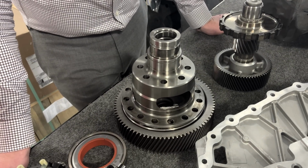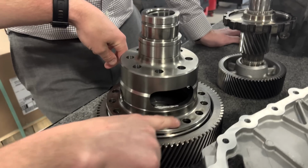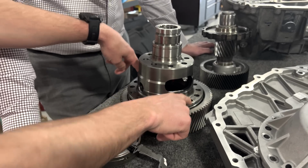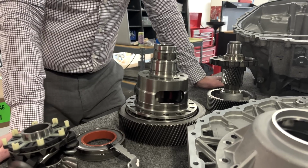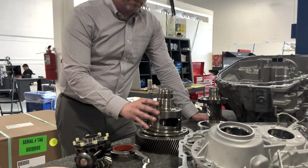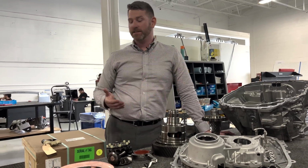The larger that hub is, meaning the span in terms of diameter between the hub face on this side versus the opposing side, that's going to be better for torque management. So a lot of little indicators as we look at this gear drive unit. And this is the front drive unit. It's pretty substantial in size, but obviously this is a rear bias vehicle, much like the Lightning.